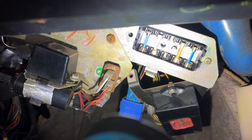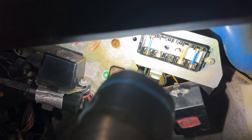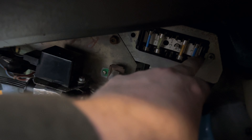Looking into the issues with my hazard switch, I've been checking under here. Number five fuse I've just changed out because it wasn't showing as very good on my reader — probably because of the grime on the contacts. I've put the original one back and a two-amp fuse in there — it should be three but I haven't got any.